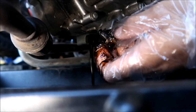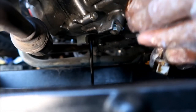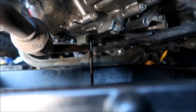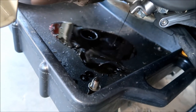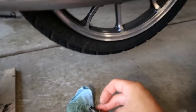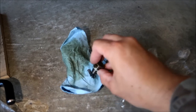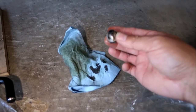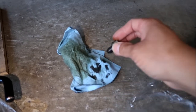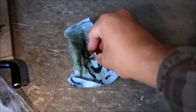There we go. As you can see, there's a good amount of filth on that magnetic drain plug — the drain is pretty dirty. That's why we've got to change it. These magnetic drain plugs really do work — there's a lot of metal shavings and stuff in there, a lot of metal-to-metal contact going on in the engine. That's called engine wear — it's a normal thing.